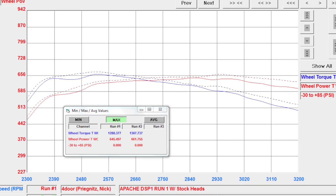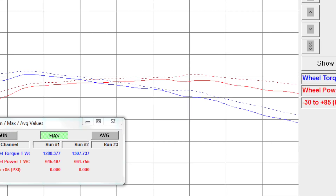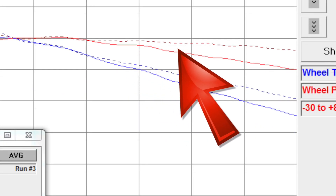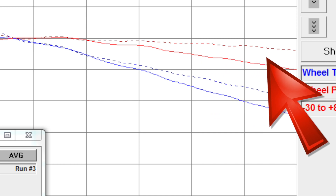The interesting thing we saw when we looked at the horsepower curves is not just the peak story. On either end of peak, you have the torque number. If you look at 2350 RPM instead of 3250, you get to see how strong the engine is at low RPM. And past peak — sled pullers will know all about this — as you go past that 3200 RPM number and start getting to 4000, 4100, 4200 RPM, you want the truck to still be making power and breathing well. What we saw on the trend lines is that past peak, the Edelbrock heads carried that horsepower better than the stock heads did, and that was reflected in the average horsepower numbers.